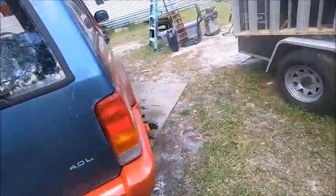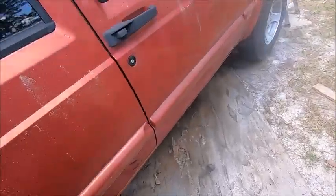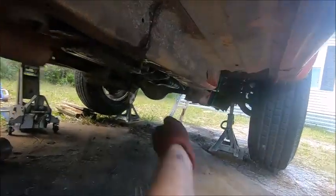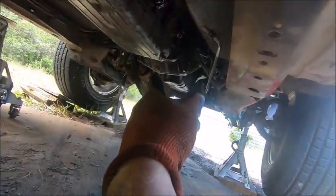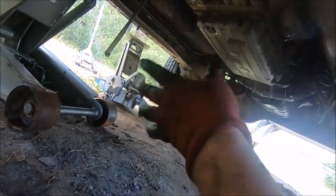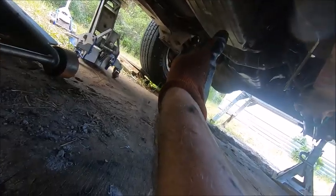All right, so the transmission is back up in place. And I have two of the bolts holding it to the engine. I just got to put the support in. At the end, I just totally ended up taking out the transmission jack because it just ended up being totally useless for something this counterweighted. If you have a lot of weight in the center, it seems to be fine, or even just a little bit longitudinally, but as soon as you get sort of counterbalanced, it wants to just throw force in the wrong directions.